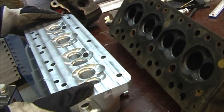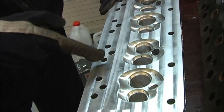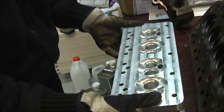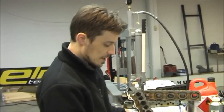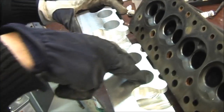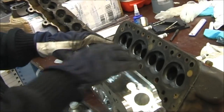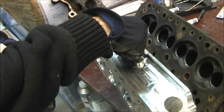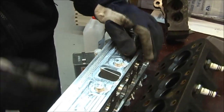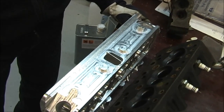This is a production prototype, so we don't have the coolant channels drilled yet, but you can see the basic head. The major change is that the intake channels have been moved to the front of the cylinder head — we have four of those. You can also see the massively oversized exhaust port; this one doesn't have the groove cut yet, but with the groove cut and the adapter plate mounted on top, you have a genuine 8-port cylinder head.